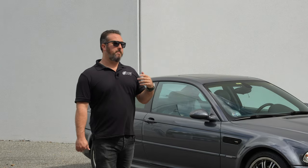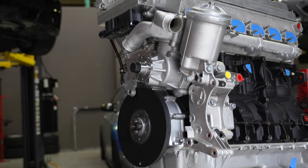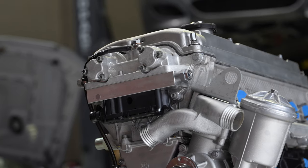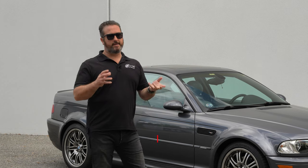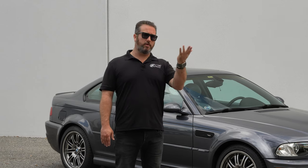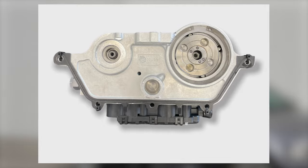To take you back a little bit about the S54 and the E46 M3: these motors have double vanos, which is variable valve timing on the intake and the exhaust side of the motor. That actually comes over from the S50 B32 that was in the E36 M3 Euros, so this motor and that motor are very similar. It's something that needs to be looked after — it's a high pressure oil system with a lot of parts and pieces, and something that we regularly service and replace. We have another one right now that we're doing a vanos unit on from Dr. Vanos, which is a rebuilt brand new vanos unit.